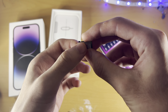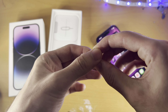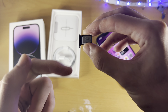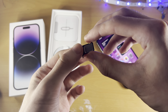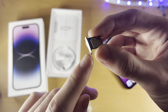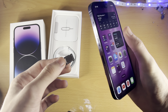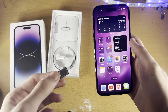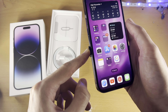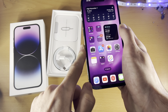Once you verify this, place the SIM card and it should fit flush. If you rub your finger over it, you should feel it sitting flush in the SIM card tray because everything is facing the right way. Now make sure the little hole on the SIM card tray is facing down. Then, with your iPhone 14 Pro facing up correctly, push the SIM card tray back into the phone and press so everything is flush.